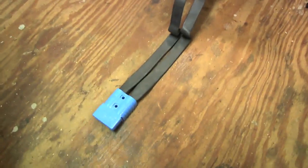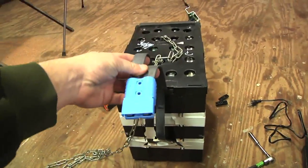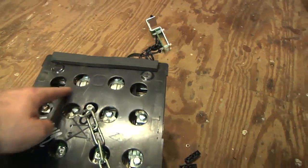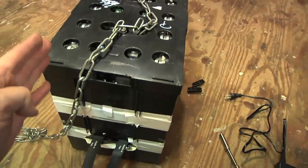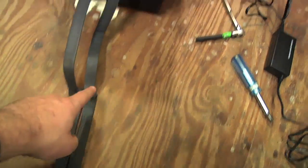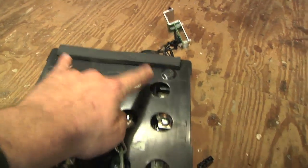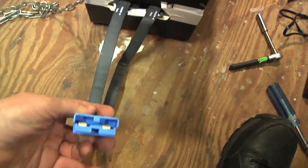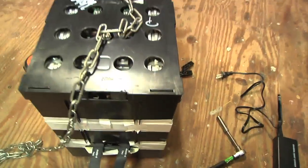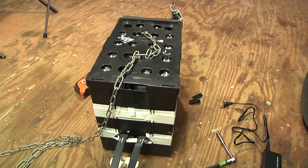On this side we can see where the strap comes off - it's kind of a flat braided strap. From the back of the motor controller you've got positive and negative, and the bus bars actually go back and forth. Then down there are three levels of cells, and then out through the other battery pack and back. So I can't charge this simply by putting a charger across here. What I'll have to do is apply power across the end, short it here, and then I should be able to charge this at about half of the 125-volt rated voltage.